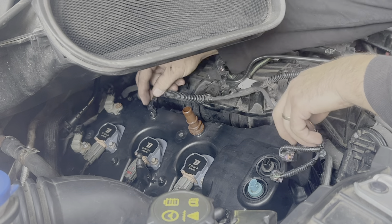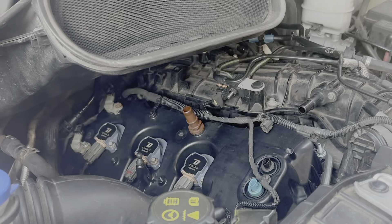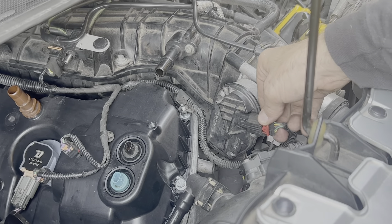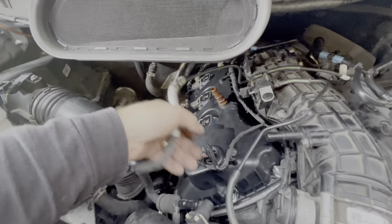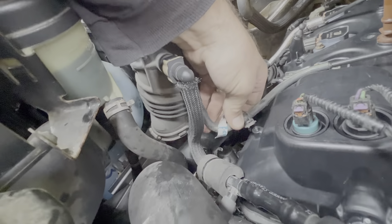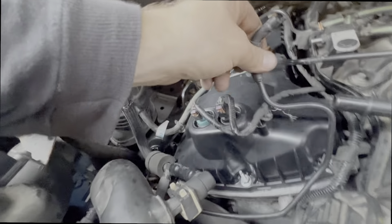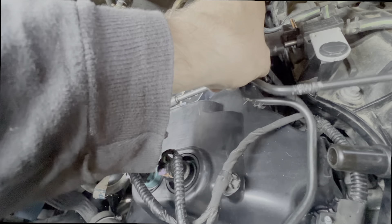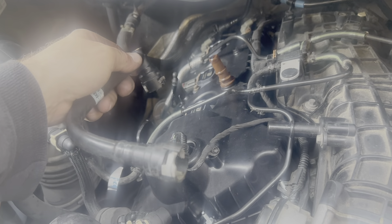Then I'll do the top wiring harness, clicking all of the plastic fasteners into place and coupling all the connectors. Don't forget the little metal clip that goes in this one — pop that clip in, then plug in your throttle body and both of the VVT solenoids. When replacing the vacuum lines, the one on the back goes down to the wastegate actuator and has a little clip. The one on the front goes to the intake tube and also has a clip if it's not broken. Then there's a third one that comes out of the turbo piping — this is the one with the hose clamp.